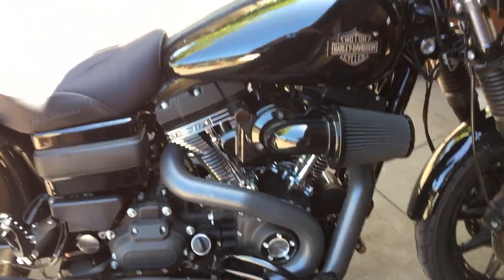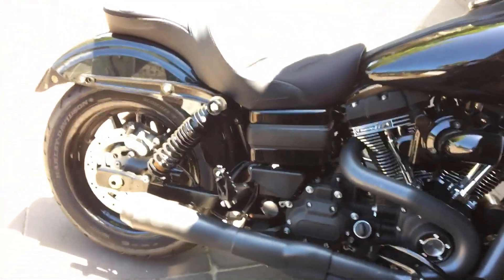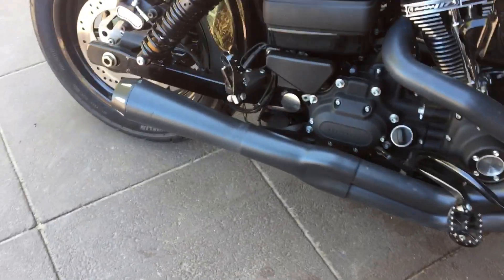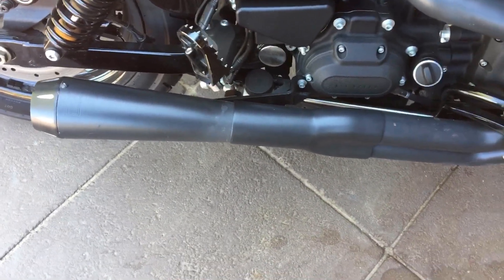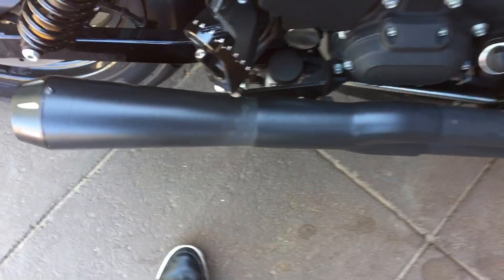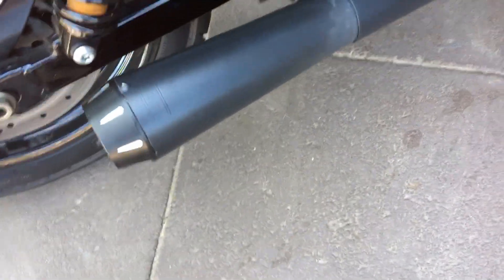This also isn't a standard bike — this is a 2016 Dyna Lowrider S but it has a Stage 4 117 in it. Let's try to get some of that low end back. After a lot of trying different stuff with the baffles — cutting it, putting it in different spots — I actually had two of them. I put one right here and one right here. This thing had so much back pressure that it tore the baffle right out of the hole I put in the pre-existing baffle.